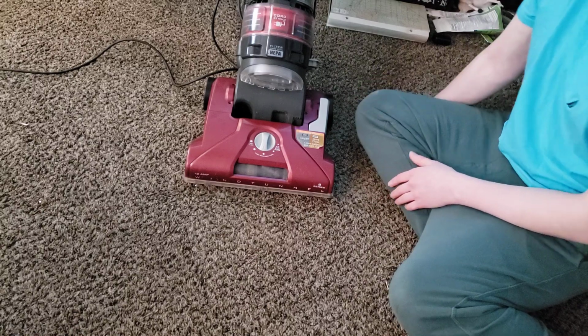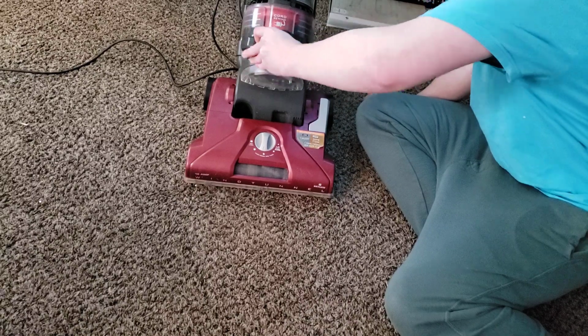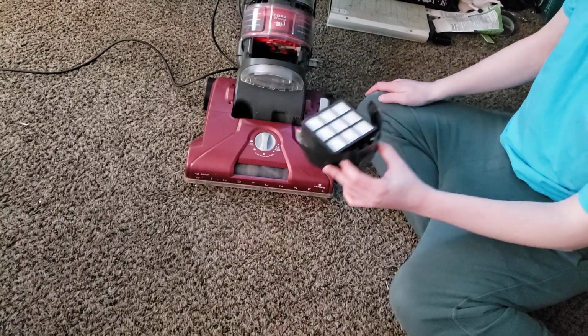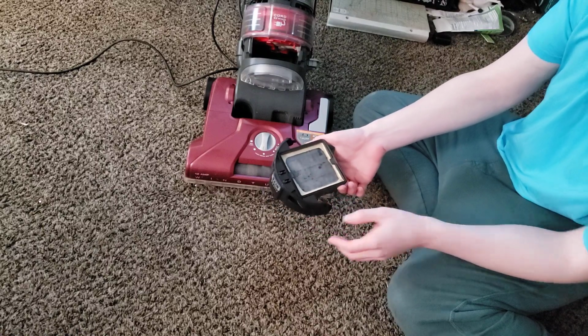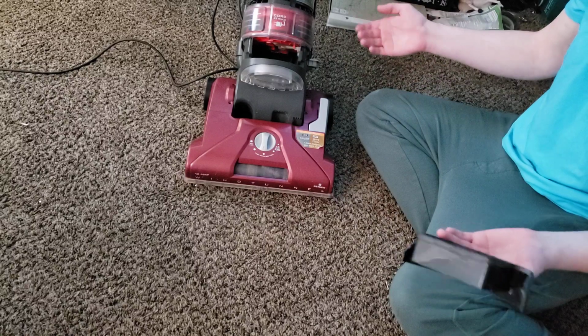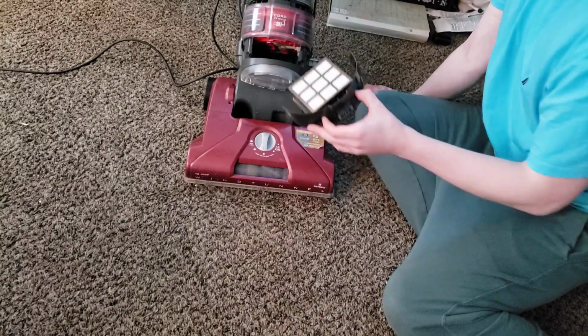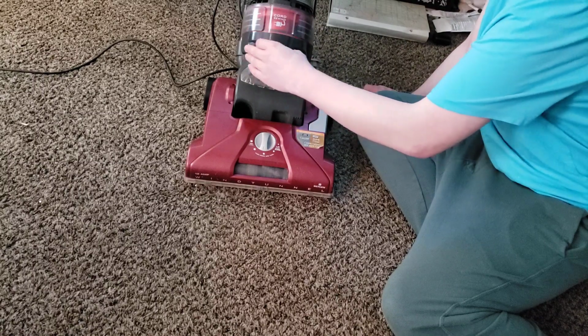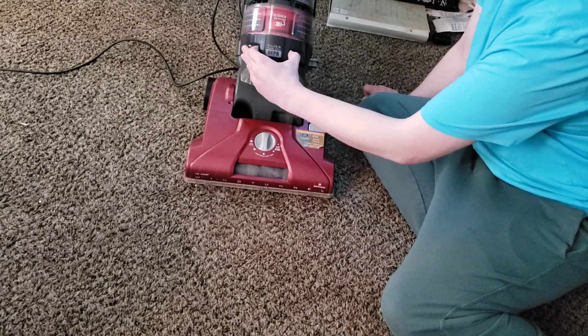So you have options. Right above here, we have a HEPA media filter. Just pull this straight out. Makes a very loud click noise. So we have a HEPA media filter on top and then some pre-carbon filter on the bottom. This filter generally lasts about 2 to 5 years, depending on your usage. If you really abuse this thing, probably you want to change it annually. And that just slides right in there. You want to make sure the HEPA wording is upright whenever you try to put this back in.